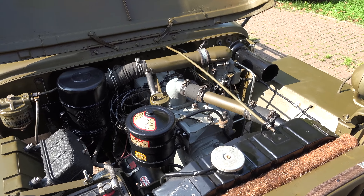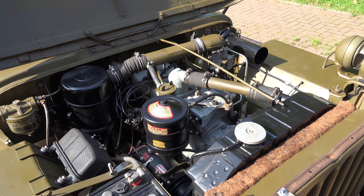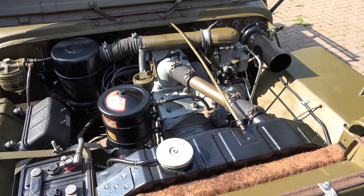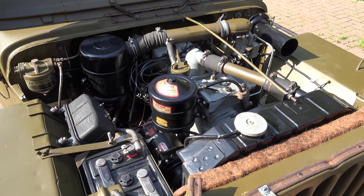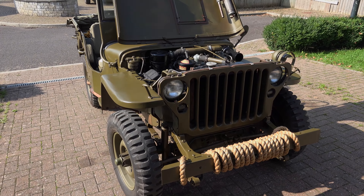A spray of WD40 goes on quite nicely after covering it in paraffin and cleaning it. You can see in areas it's starting to dry out itself, leaving a nice sheen. Under the hood it's drying and it makes it look really good. She's running well at the moment. We'll have that differential looked at over winter — it's still fine but probably needs looking at. The head is also starting to make a little bit of ticking from the forward valves. I changed a couple of valves and tappets that were out of tolerance when I rebuilt the engine, but there's a bit of ticking going on there.